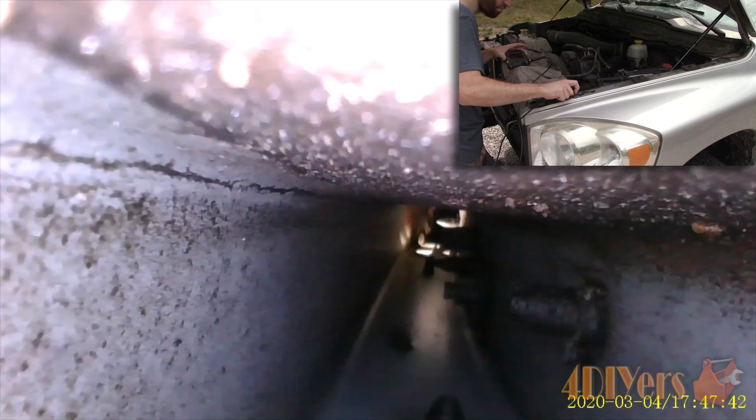This is unedited sample footage that I took with the camera, viewing components such as tags inside the frame for inspecting for rust, behind the fenders to determine if they've been patched, behind the rockers to determine if they've been repaired, leaks around seals, etc. Being in Canada, I know frame rot can be a serious issue and the camera alone can prevent making a bad purchase. Frames can easily look good on the outside regardless of whether they've been repaired or are original. However, having a view on the inside can really show what's behind all that.